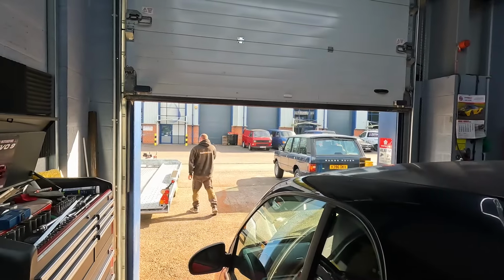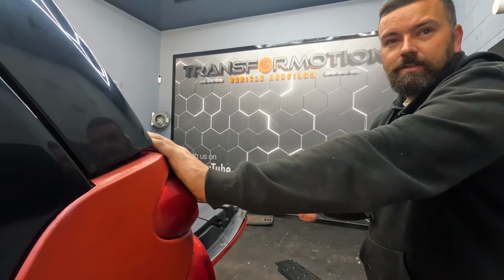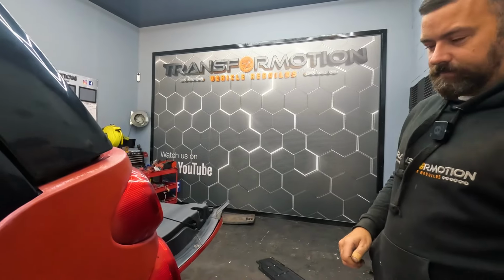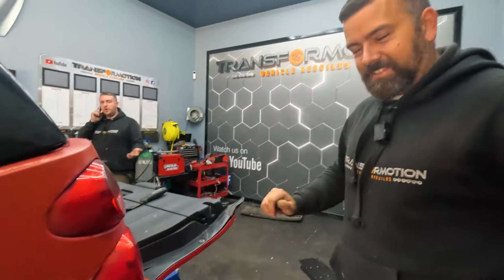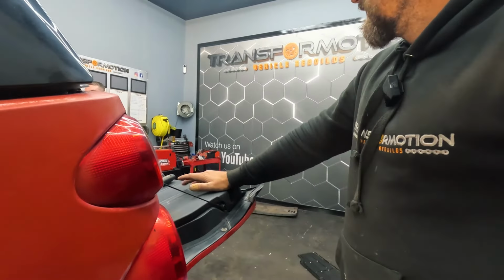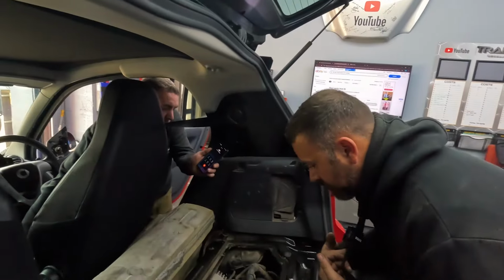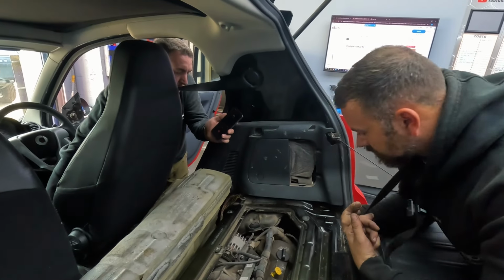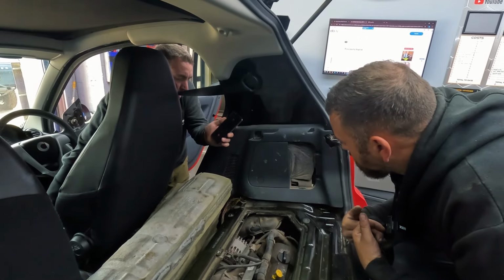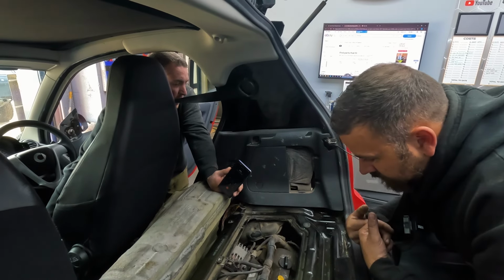This has got an automatic clutch selector, you know what I mean? As soon as you crank the key, you get a proper loud knock, as if an exhaust is banging against the side of the car. But we got this free for fixing the other one, remember? Just listen. Hang on. Can you hear it? Yeah, as soon as you touch the key.